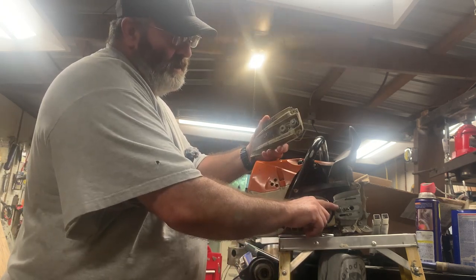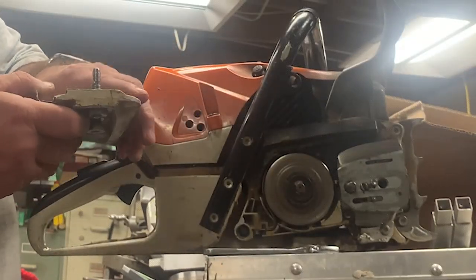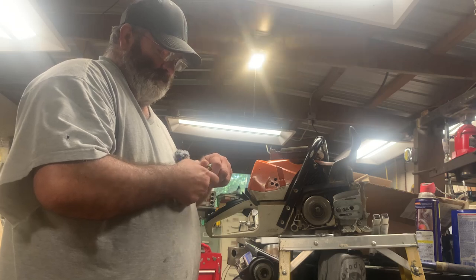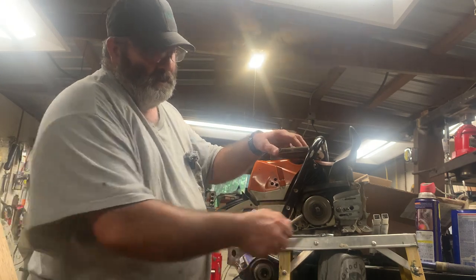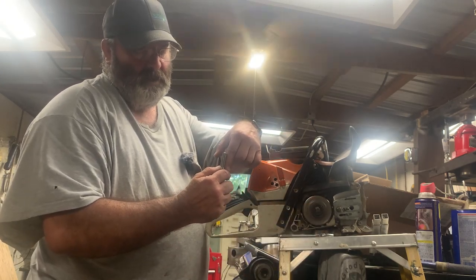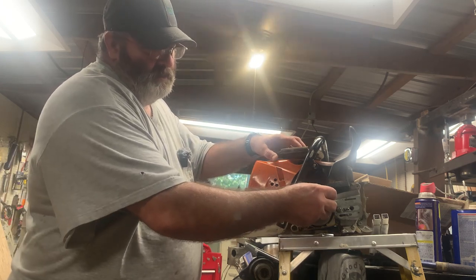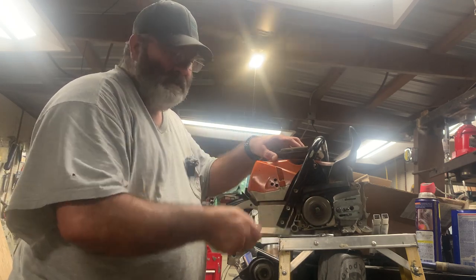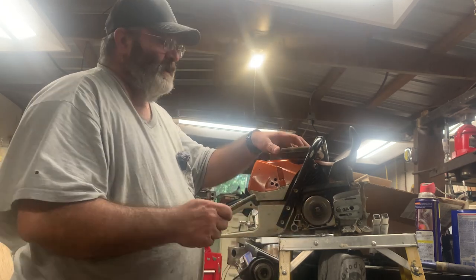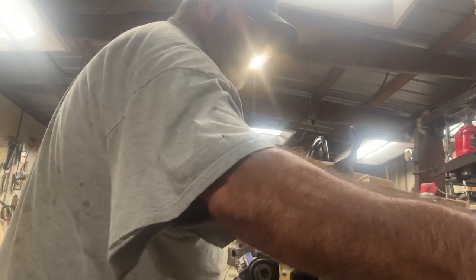Now this stud back here, the original studs, you can judge by my finger, it comes up to the first knuckle. That's about how far the original stud goes in there. But this one right here, let me show you how far it goes in. Because it is a bolt just exactly like this one that I used to fix this back stud. It goes in that far, which goes up to my second knuckle. So it's at least twice as far into this frame that this bolt goes. And I also Loctited it with red anaerobic Loctite, and that's holding in place. I don't even think my guys can pull that one out. So let's get this off here and then we'll see about getting us some measurements.